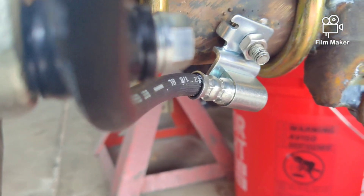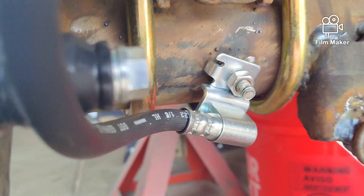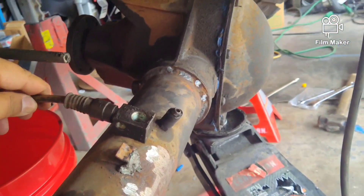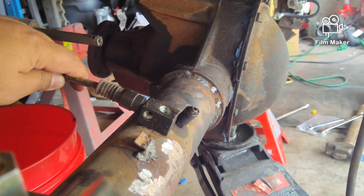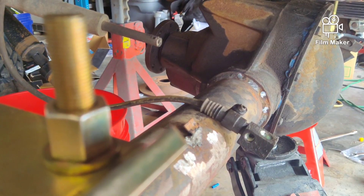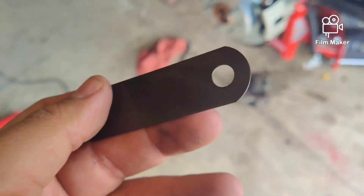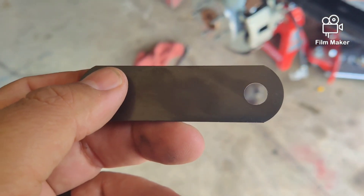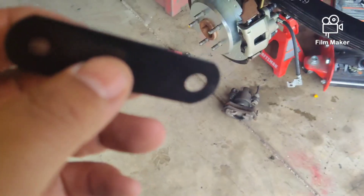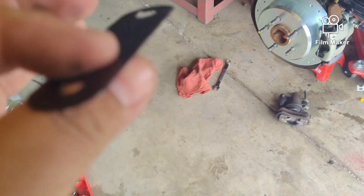But this bolt was welded on to work with the stock Explorer brake line and it's not going to work with this setup. I'm going to have to cut that off and move it up about an inch, otherwise my brake line is going to hang too low. I also need to weld a bolt to hold the line here so we can run the brake lines accordingly. New idea — instead of cutting and welding the bolt, I found a piece of flat bracket. I might just cut it down to the size I need, bend it to shape, drill a new hole in it, and run a bolt through it just to hold the line up for more ground clearance.